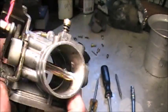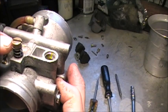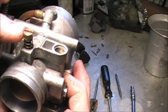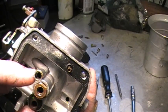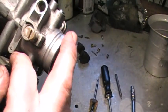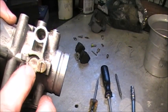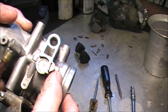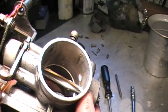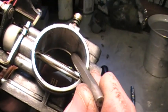Now inside these Mikuni butterflies, that's the intake side here, the air goes in there, this is the engine side. The low speed air adjustment or gas adjustment is up top. So the fuel actually is sucked in the pilot tube through a passage which comes up the carb up top here, weasels its way through this Welch plug, which is, I wish I had a bag of those Welch plugs, we'd pop that out. There could be pollution in there. And the idle mixture is adjusted with that screw. But inside the carb, and you can probably see, there's three little holes down in here.